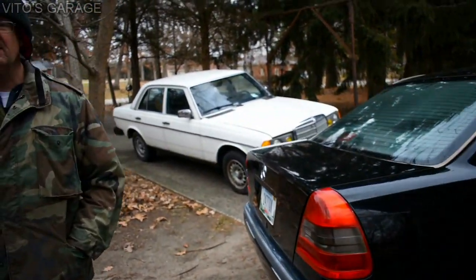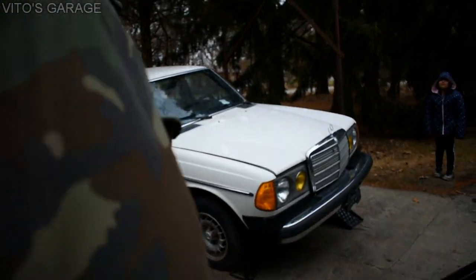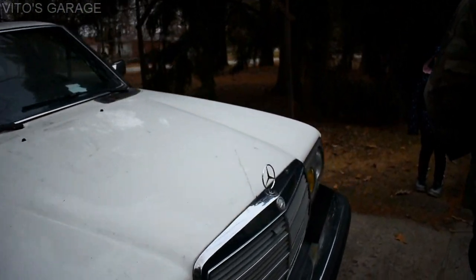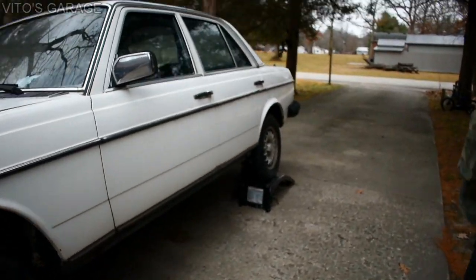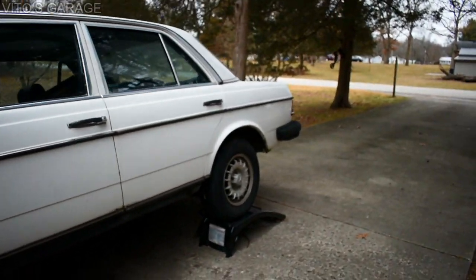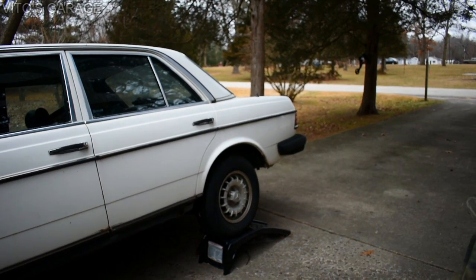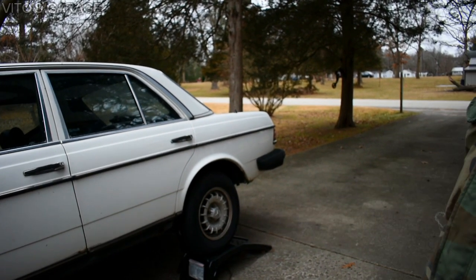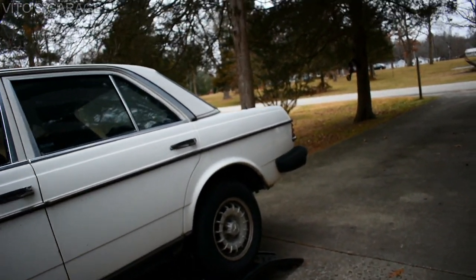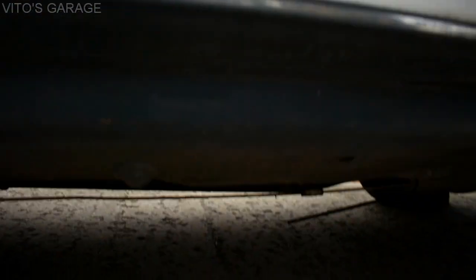How's your Wilma, the W123? She's got the gold in the house — stay warm. I took the tank out, pressure washed it inside, and treated it with the organic treatment. All of the fuel lines were garbage — they were bad. So right now if you get under there, you can see I've already started bending the new lines.